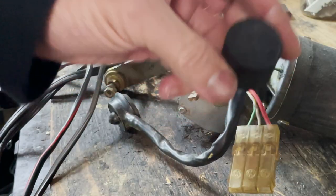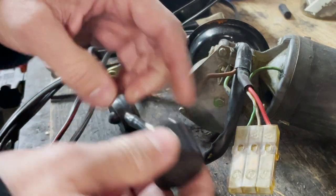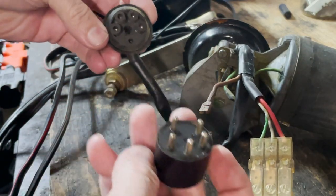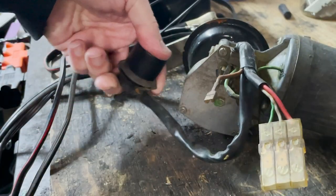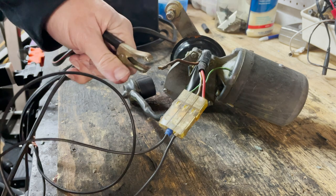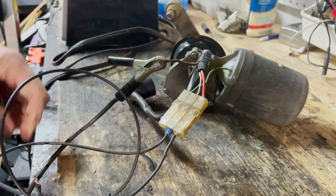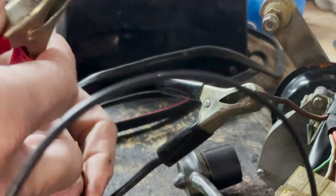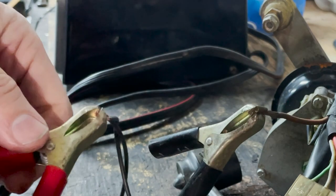To test it we have to put power on the red and then either the green or the gray, and also some ground to the brown wire. First I want to make sure I have a known good relay because the motor needs a relay to actually work, and I don't want to be chasing whether it's the relay or the motor that's bad. So I'll take the negative lead from my power supply and put that on the brown wire, and for the positive side I've twisted the two wires together going to the red and either the gray or the green, and hook that up to the power supply.